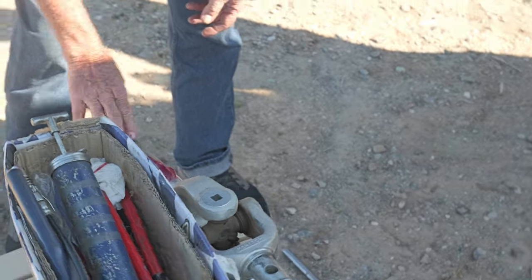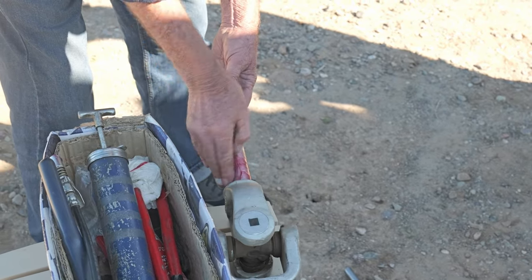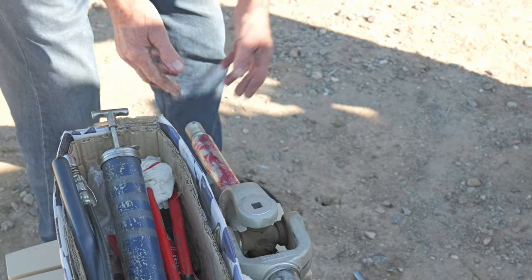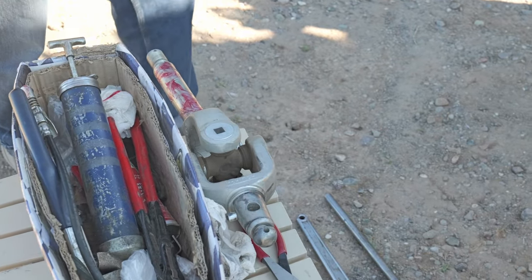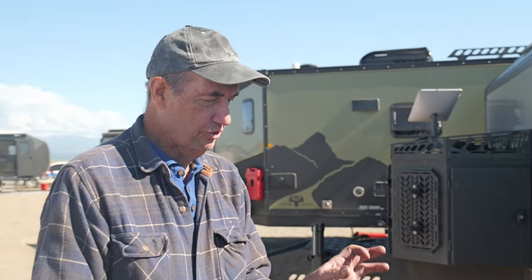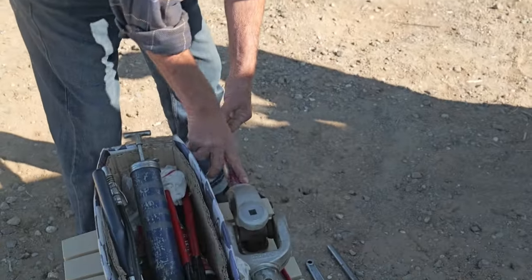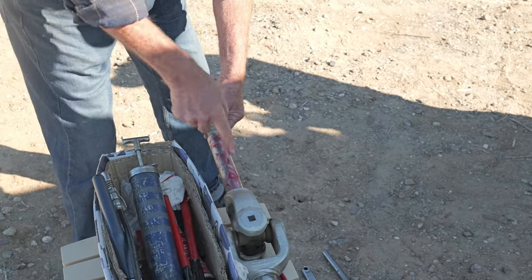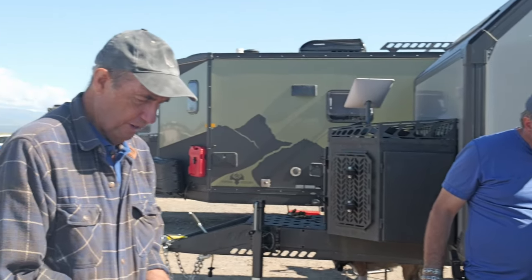Is there any issues with using a weight distribution hitch, like the Easy Hitch Easy Out of Provo? I've never had any issues — it's fine. This works really well with the weight distribution hitch. One thing on the truck: the receiver piece has to constantly point back, indexed so it can't turn. There's a square washer we weld under the hitch head that indexes the receiver and points it back — I have those washers if you ever need one. I don't like anybody to use a weight distribution hitch unless they're using the six-ton model. These are so strong — they'll never break no matter what.